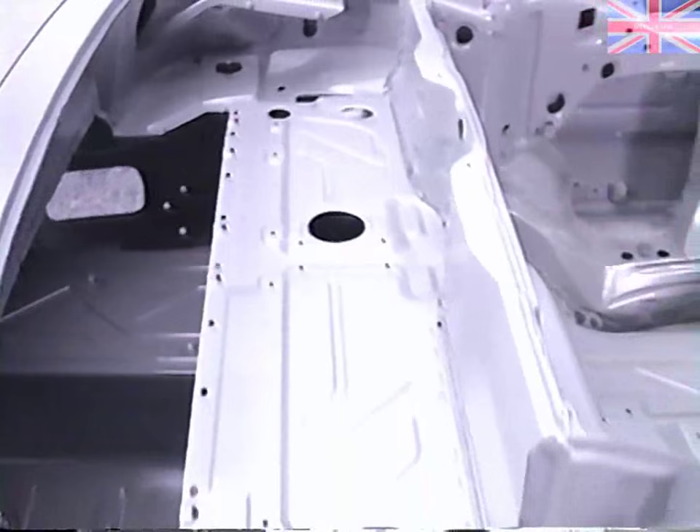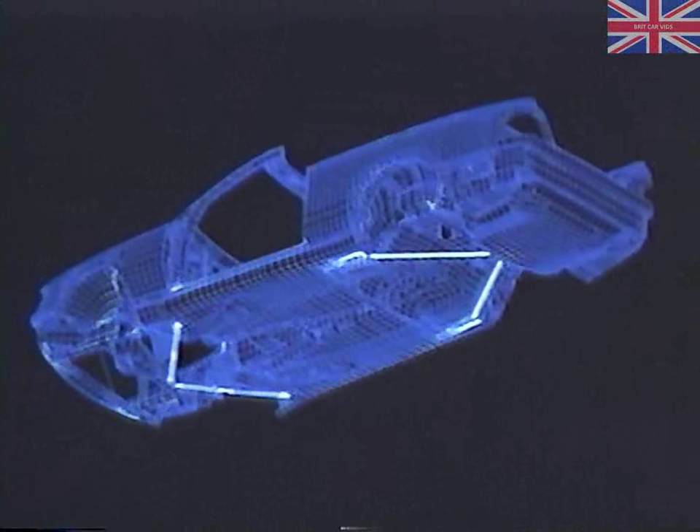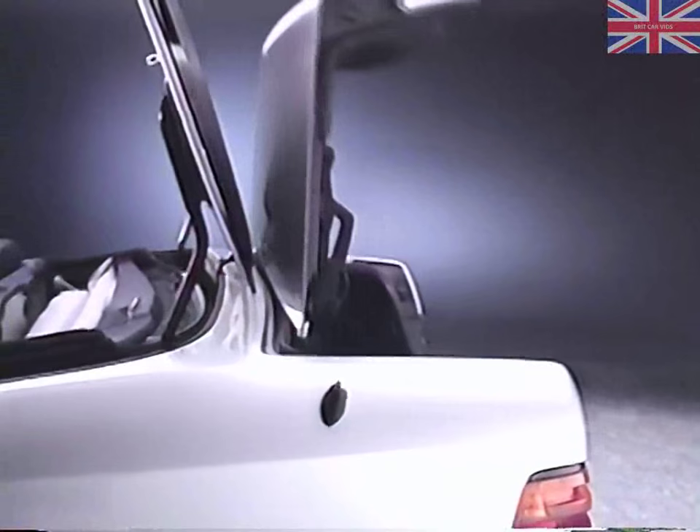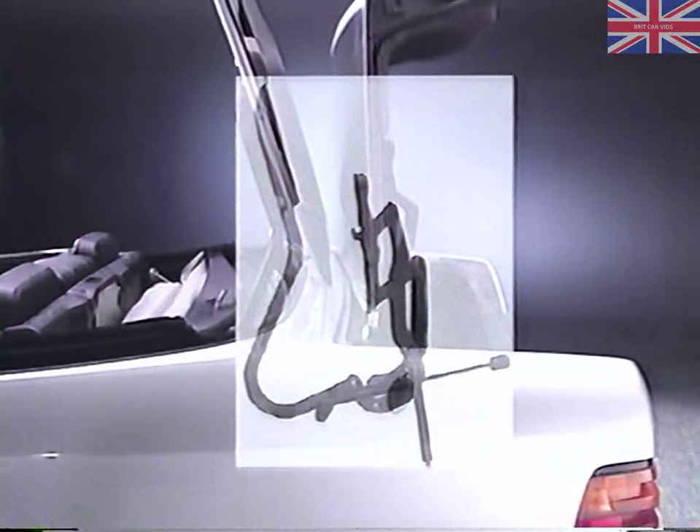The rectangular steel box behind the rear seats that houses the soft top assembly has load-bearing sidewalls that provide transverse stiffening. Diagonal braces underneath the frame floor keep flex to a minimum. Multiple hinges are used to prevent contact between the trunk lid and the soft top compartment cover.